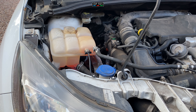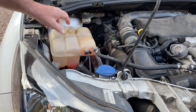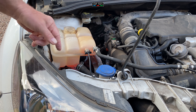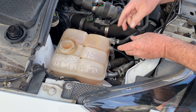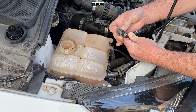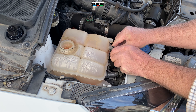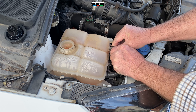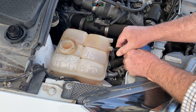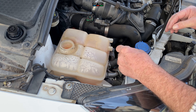The first thing to do - if you have got coolant in it and you want to change the bottle, you want to bleed the system. Take an air thing and suck it into a bottle. But because this is virtually empty, we can take a pipe out of there. Two clips - push and lift that one off. There's a clip as well, be a little bit tight - obviously don't snap the clips, just got to get them off. The clips on there, literally push in and pull.